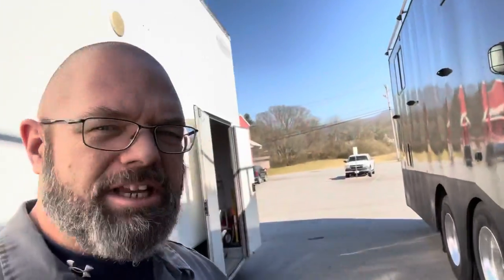Well, guys, there you go. You can hear how bad that leak is. In fact, at idle, I couldn't get the truck to maintain over 100 pounds of pressure. It was actually staying in that 90 to 94 pounds, which is definitely too low. Now, going down the highway, with the engine at a higher RPM, it was maintaining on our way back from Texas. But either way, it's got to get fixed.